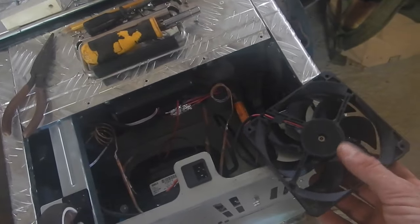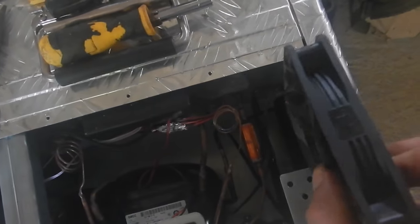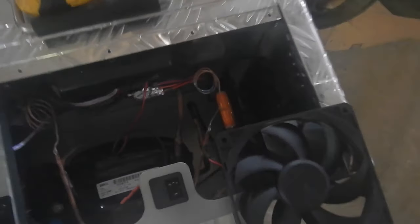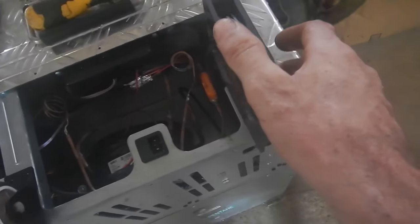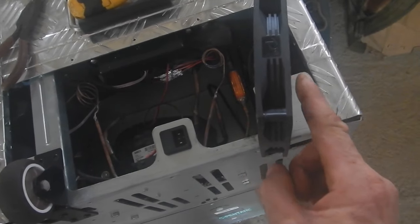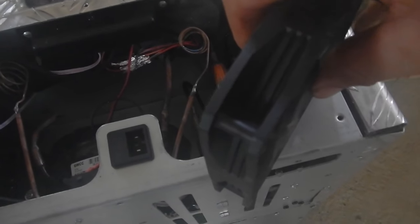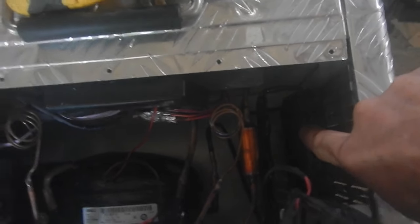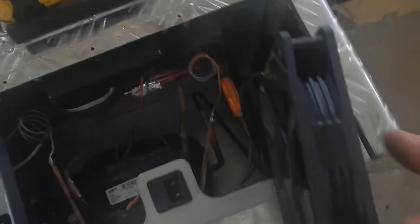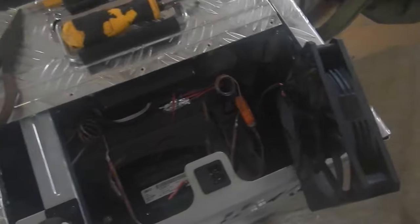I started taking all this apart and I remembered hearing a noise from the fan. This fan fits right down in there between these condenser pieces. What happened is the fan propeller blade came out too far — it's supposed to sit further in. When it's sticking out like that, it hits the housing. At first it was just tapping, then it totally stopped because this thing fell right off.